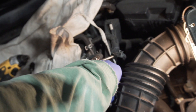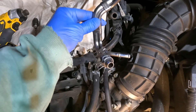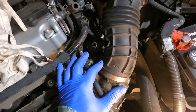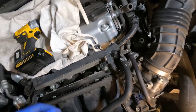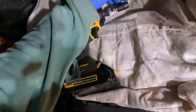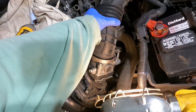There are lines all over the place we've got to pull out of the way. This piece — I'm not sure what it's called — has something to do with coolant and vacuum. Next, remove this intake hose. You can use a Phillips head screwdriver or a 10-millimeter socket. I'm going to use a 10-millimeter socket with my drill to make it super easy. Go ahead and pull these off — you can see how easy this is.